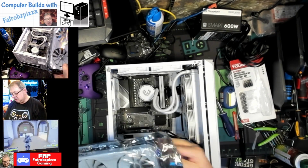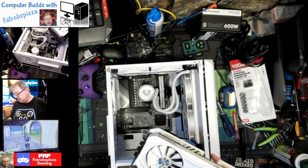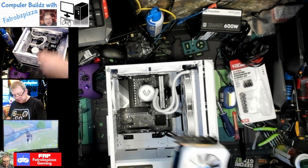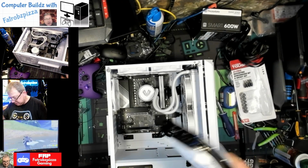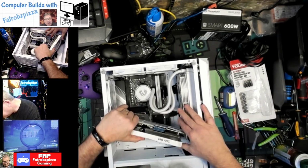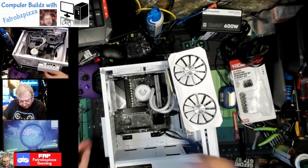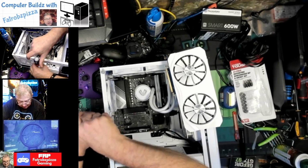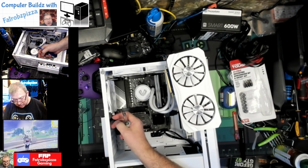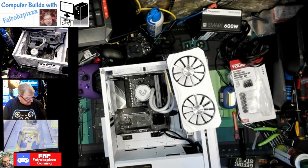This was that ARC A770, 16 gigabyte Sparkle, 16 gigabyte in white. This is the Luna edition. Remove that thing there that covers those connectors. Okay, now let's see where this thing is going to go. It's going to be quite a tight fit. So it's going to be those top two. We're going to remove this one here, and then the other one is a breakaway. This one is held on with a screw. I'm going to save that screw to the side. Now these breakaway ones, you just push in on them, and you wiggle them, and they pop off. That's trash.